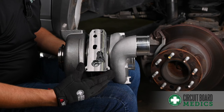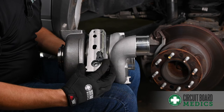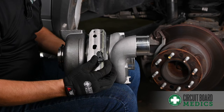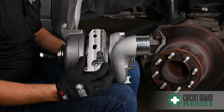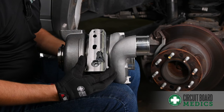I have a new turbo here to show you the sector gear. Once you pull the actuator off, you want to make sure that your sector gear travels fully — you'll hear it click to either side. It travels about an inch. If it's bound up or not moving easily with just the push of a finger in either direction, you may need a new turbo.